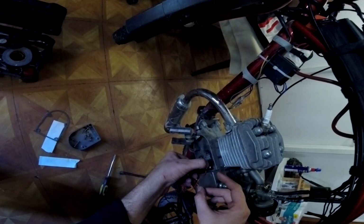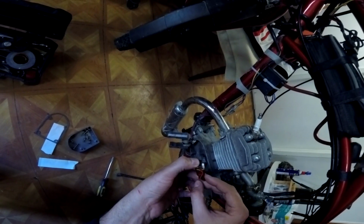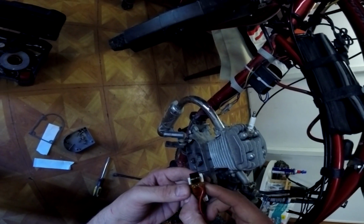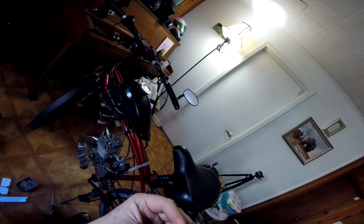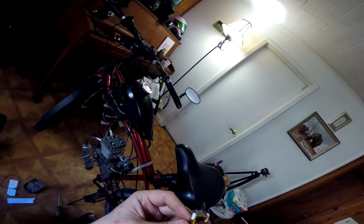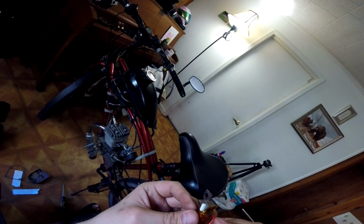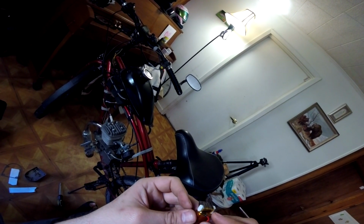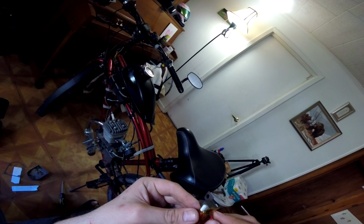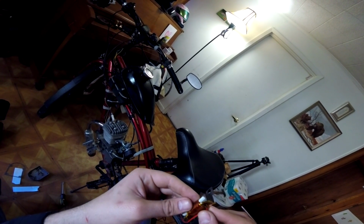These coils that I'm installing in the motor right now, which are designed for these motors, they'll work with halogen bulbs because halogens will work off of alternating current. They don't care which direction the current flows. They simply take it and they heat up and they produce light, which is why I think that this would work with a halogen headlight, a halogen taillight, and even, I believe, halogen flashers, which vehicles have used for a long time.